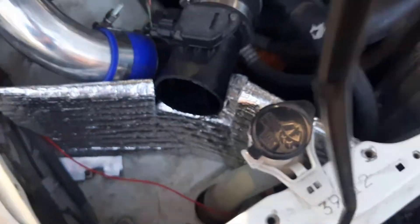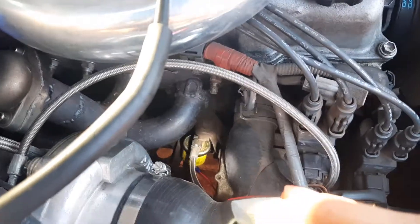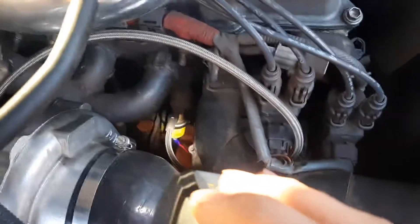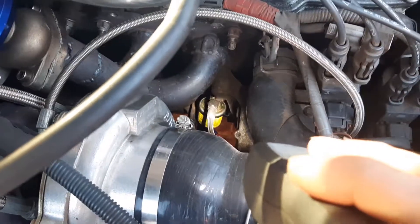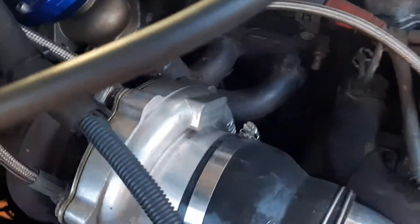Following that wire around, it goes under the dash, comes out on the side, coils around my intake - no air filter, I know - and goes down to the original oil pressure sensor unit for the 3RZ engine. It's a 1/8th NPT fitting tapped into the block. Where the original sensor unit goes, there's a T-fitting: one side goes to the oil pressure sensor with the red line running up into the gauge, and the other line is the feed fitting for the turbo - high pressure oil from the oil pump going to the top of the turbo.